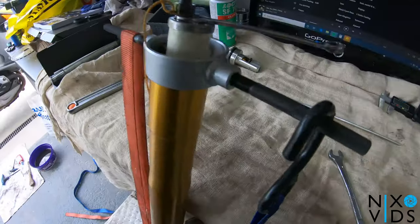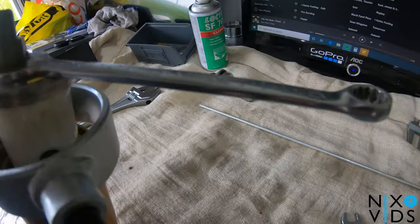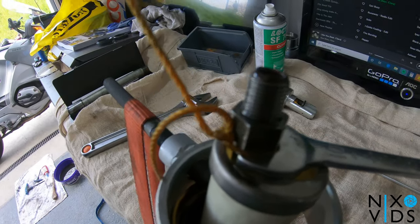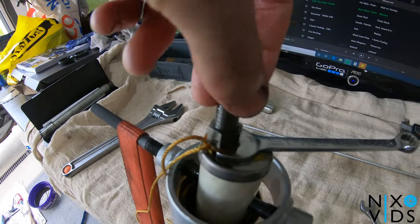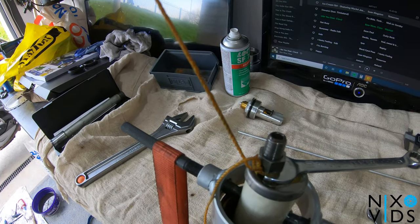Remove the rod. You're going to need to tie something around this rod here because once you remove the tension device you won't be able to get it back. I've used string, but I advise using either wire or actually threading a bolt onto the top, because the string snapped the first time on the first fork.